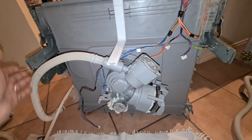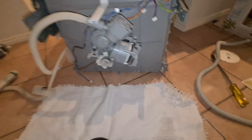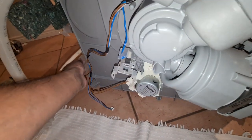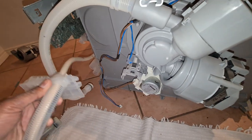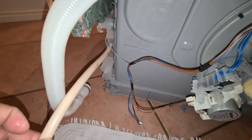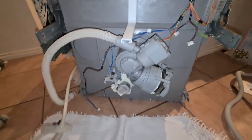What I've basically done is removed the base frame, which makes it very easy, and then you can lay the control board on top of the dishwasher like this while everything is at the back. I've disconnected the drain hoses — both the internal and external — and brought the inlet valve through the entire assembly without actually disassembling it, which makes it very easy to put everything back together.